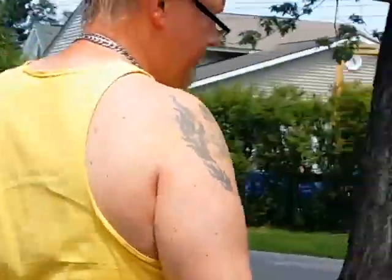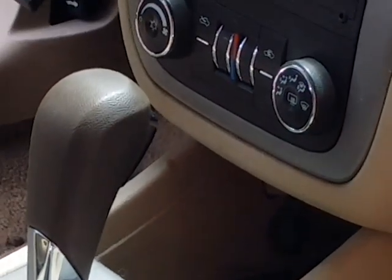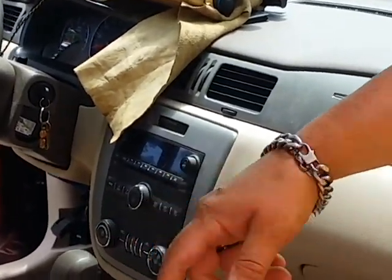Hey YouTube family, I've had a problem with an '08 Impala in the past — I went to turn the ignition key and I couldn't get it out of park. There's a solenoid that releases and lets it out of park. If you come around the passenger side, right up under here, about in line with this — you pull on the side and reach in, there's a button you can push that'll release it and let it come out of park.